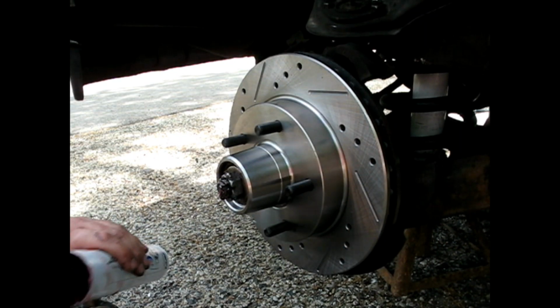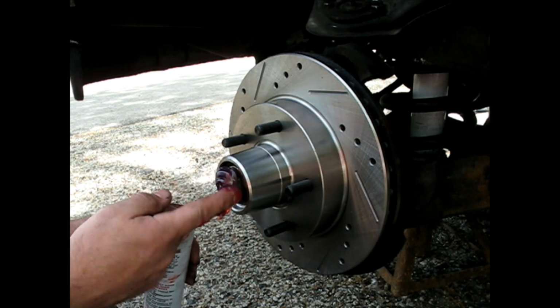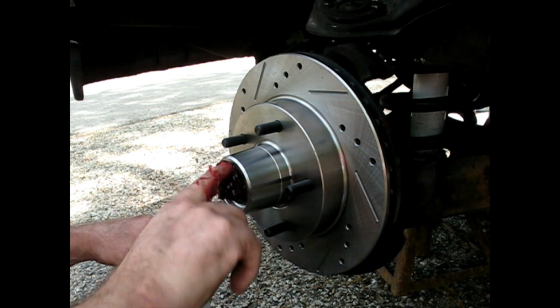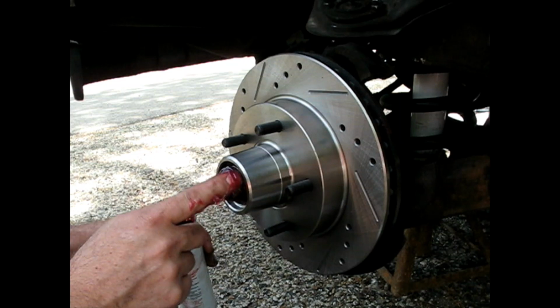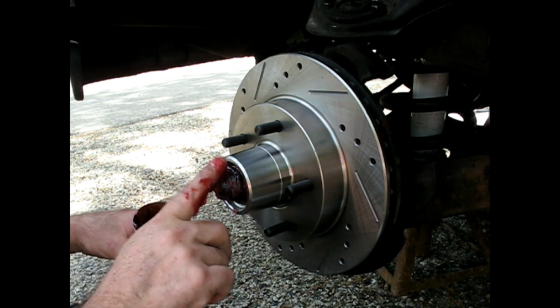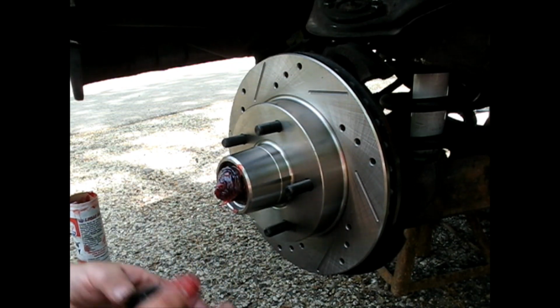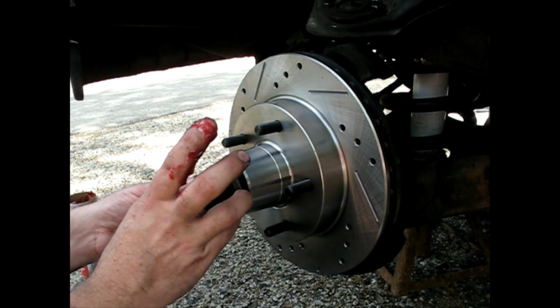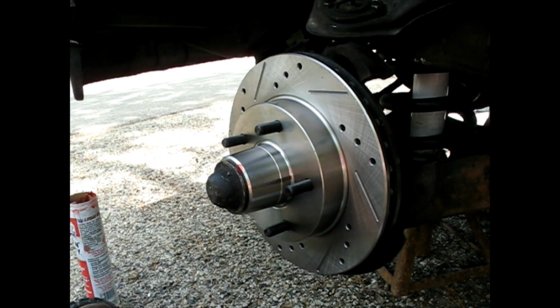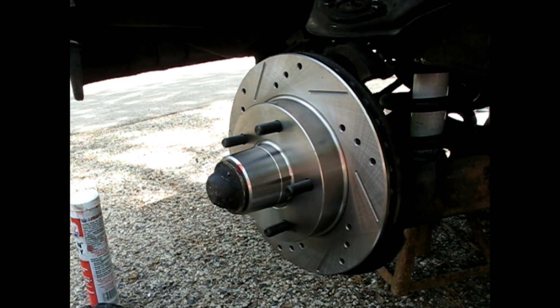All right, we got that all set. I'm just going to add some more grease here. It stays inside the cap. And if the outer wheel bearing at least was ever to heat up, you'd have something in the cap to potentially melt and nourish the dry bearing. Not necessary, but I think it also helps keep a lot of the water out. If you ever forded any water, it would help make a seal so the bearings themselves wouldn't be getting wet. Not that I'm planning on fording any water, but you never know. With the weather, you might run into a situation like that.